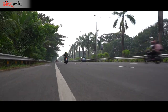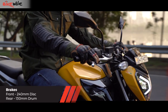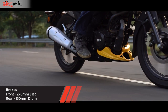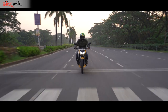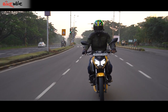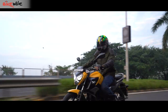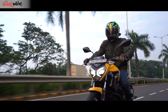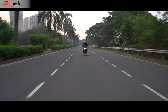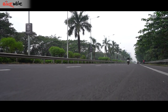While the engine features a commendable nature, the same can't be said about the braking setup. The front setup feels hard and doesn't deliver confidence-inspiring feedback. The setup works well when used along with the rear brakes — the combined braking system applies some pressure to the front disc when the rear brake is applied, and it feels better this way. It may not appeal to seasoned riders, but the Raider 125 will be bought by people either buying new or upgrading from the 110cc segment — riders who typically use rear brakes more than the front, which justifies the setup.